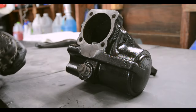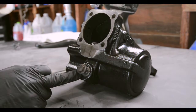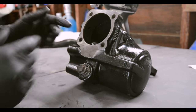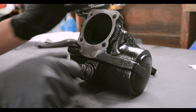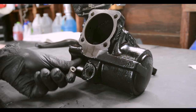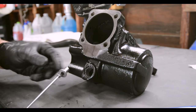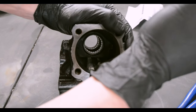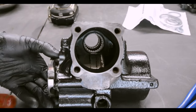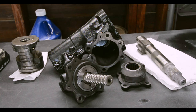Yeah. Well, that was a detour I really didn't want to take, but nonetheless, while I was waiting on a new power piston nut and my rebuild kit, I went ahead and cleaned up all my parts. So, here's how this should have gone. Power piston nut comes out, and a spring, and you got your power piston plunger, and you got your power piston guide. Now we can take that piston out. Just take a little flathead. Just like that. Congratulations, you've pretty much taken everything apart now.